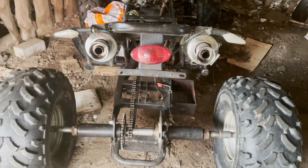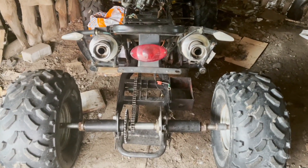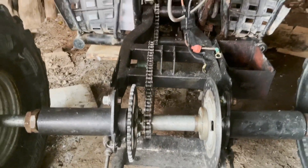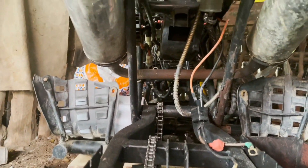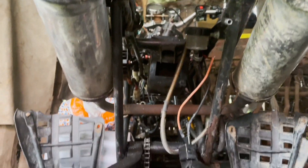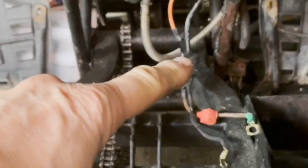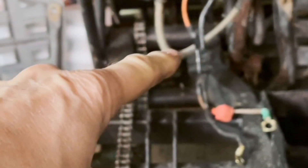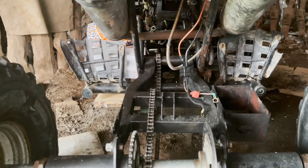I don't think it's going to turn up, to be totally honest - I think I'm going to have to buy a new one. So I'm just disconnecting everything. You can see how badly twisted that is - if you look at the shock mounts, trust me, it's out. I think what I'll do is cut the swing arm there and maybe put a cut on that side, right where it attaches to the frame, and weld it. So I'm going to take the whole thing off.